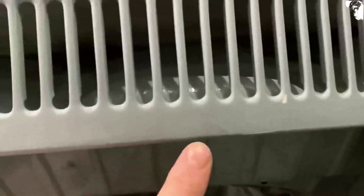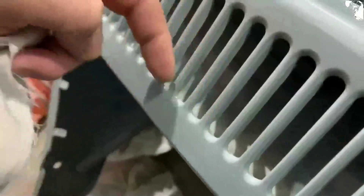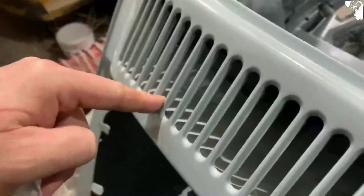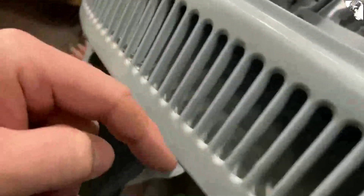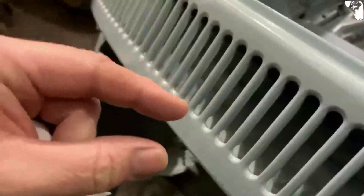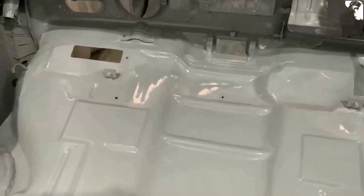There's an area that the gun hasn't quite covered just on the initial inside edge, all the way along there. I'm hoping I've still got a little airbrush that I might be able to blow in there - it's got a smaller nozzle than the actual spray gun. Just getting those runs sanded with 600 grit. There's quite a big run under there that I've sanded away now - it's nice and smooth.